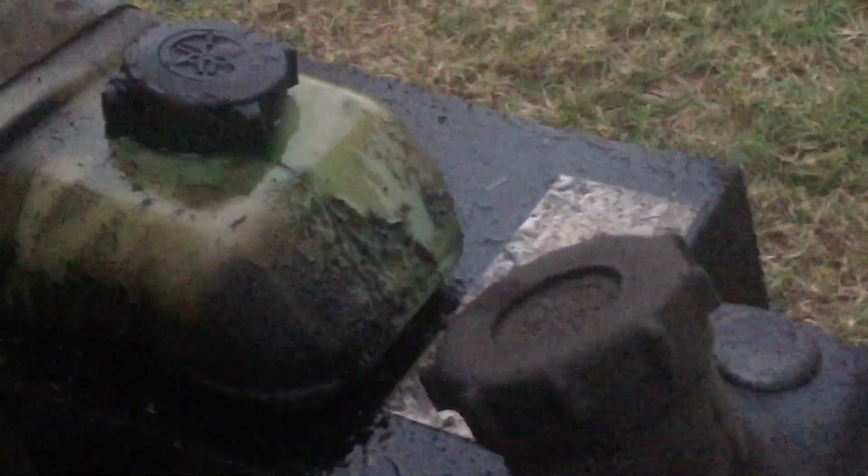We've got the motor broke in, ran it through about 3 or 4 heat cycles, and the muffler was packed full of carbon and oil, and got the fuel system working, the oil system's working. It's got an oiler. The only thing I have left to do is to find a good cap. You can see it's splashing a little oil out, more than a little, but it does operate. Fuel pump's working, tank's clean, and it's charging 14 volts.